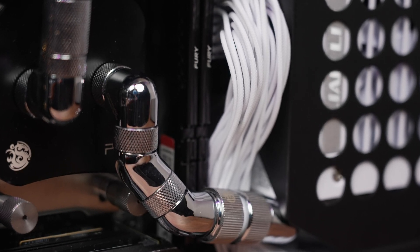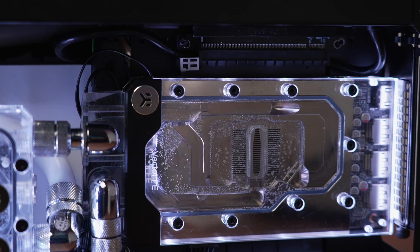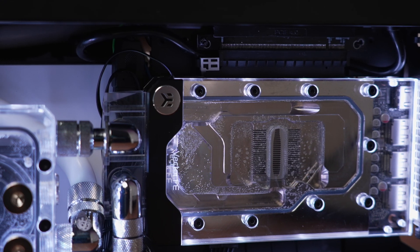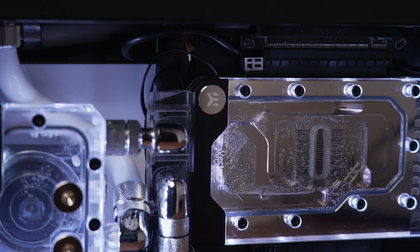For a gaming combined CPU and GPU use scenario, the CPU was holding 5.5 GHz on the single-core boost — absolutely no problem, no surprise there. I don't play Far Cry 6 much, but it's actually pretty good for testing the CPU. Even with just the 3070 FE, with the 7700X I was getting an average of 119 FPS and 109 for the 1% low at 1440p high settings. That's a very consistent frame time — and interesting because it's slightly faster than the 5800X with a 3080 for this title, with way better 1% lows. That just goes to show how single-core limited this title is. The 7700X is killer for games like this.